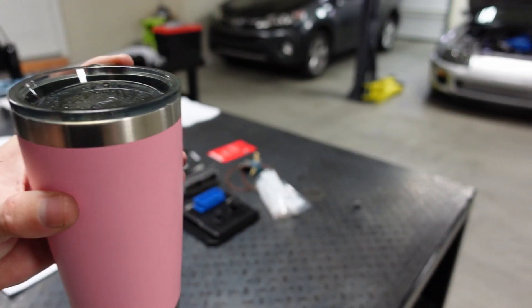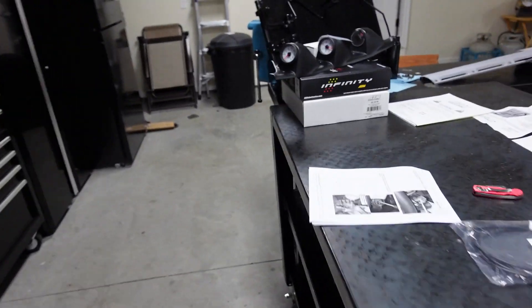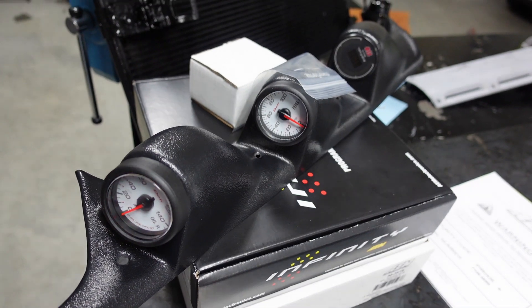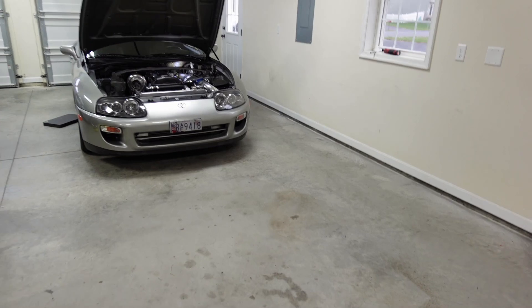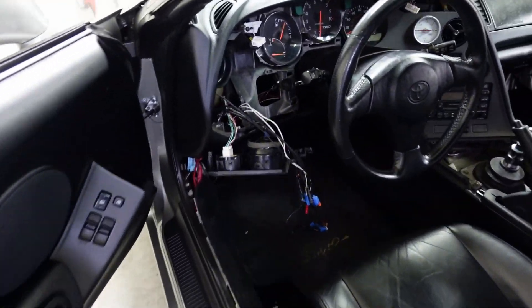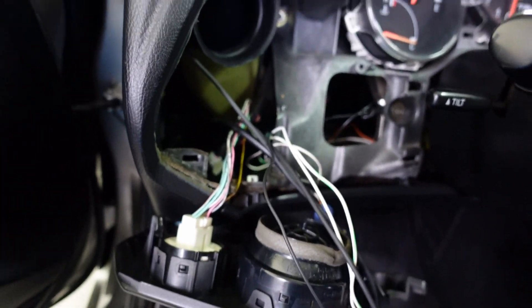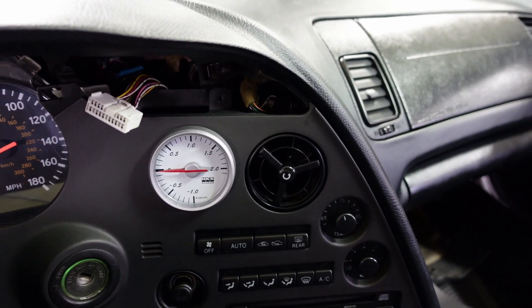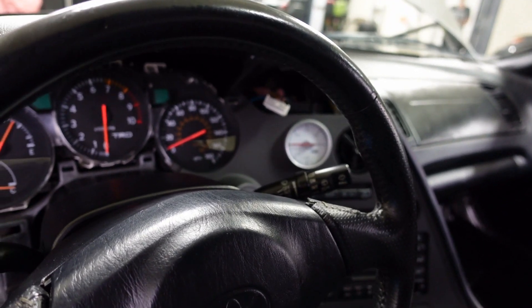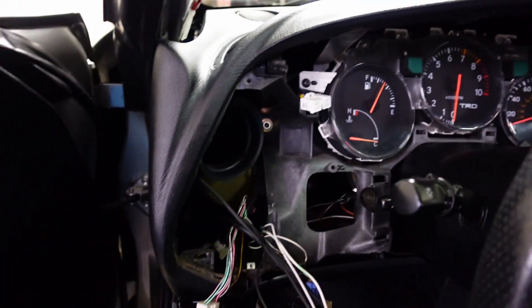It's just me now. It's morning — I'm drinking some coffee in my pink Yeti, of course. Next, Frank wanted to keep it factory looking but wanted these gauges removed. So we took those out and we're going to install a BTI gauge — once it arrives, we'll put it in the center clock area. There's a bit of a wiring mess. He's also got this big HKS gauge where he actually drilled a 60mm hole in the dash. So we're going to have to make a custom sleeve to go from 52mm to 60mm. This car also has a TRD tach, which is cool. The panels are that olive color from '97-'98 — very cool.